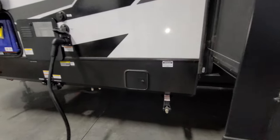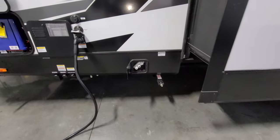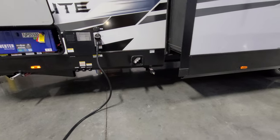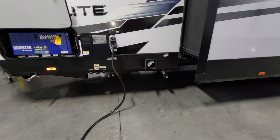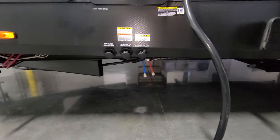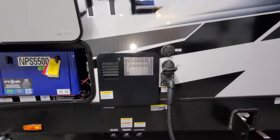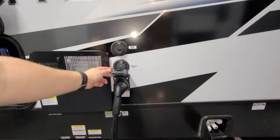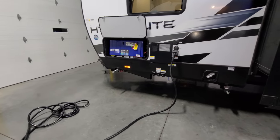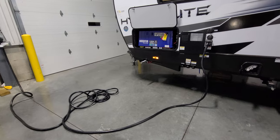Here you have a hot and cold outside utility shower and spray port. A blue hose comes with it — hook it up to rinse your toy, wash sand off after the beach, or whatever you need. The hookups include city water, fresh water, black tank flush, hot and cold low-point water drains, a six-gallon gas-electric water heater, cable and satellite inlets, and 50-amp electric service. This unit was ordered with two A/Cs, which requires 50-amp. The power cord is about 25 to 30 feet long.